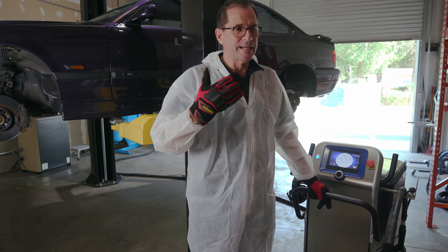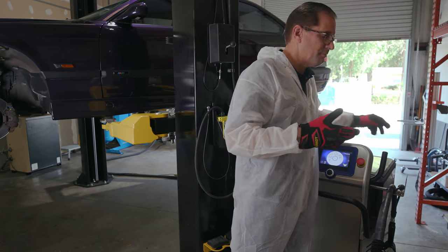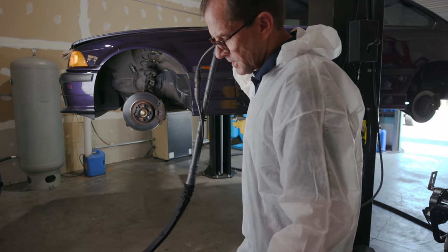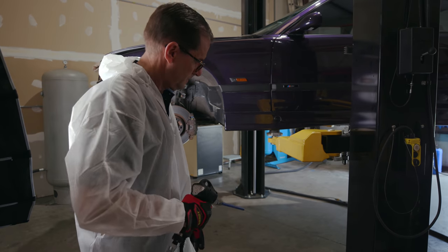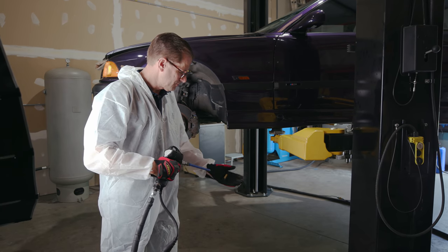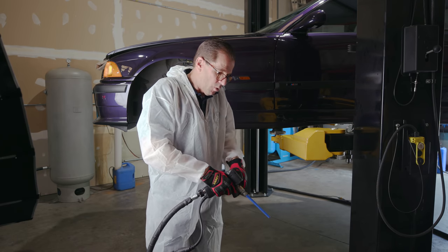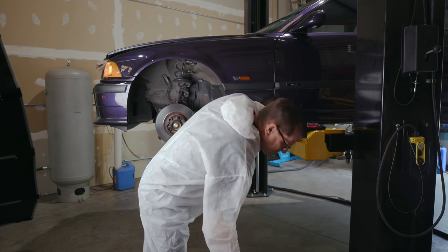So again, you're gonna notice my technique. I'm not saying it's the right technique, it's just what's evolved for me. My gun's always moving. So if you watched the video yesterday, you remember, first thing we gotta do is purge that condensation out of the line. So I'm gonna do that right here. Not too much. Sometimes I wanna test it just for sure, and I'll go down to the ground, spray directly down to the ground, and if I see water going out, then I know I still got condensation. Yeah, I'm dry, I'm good.